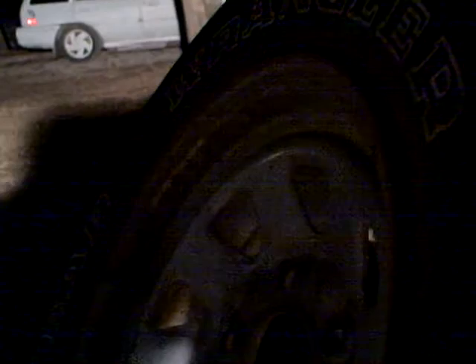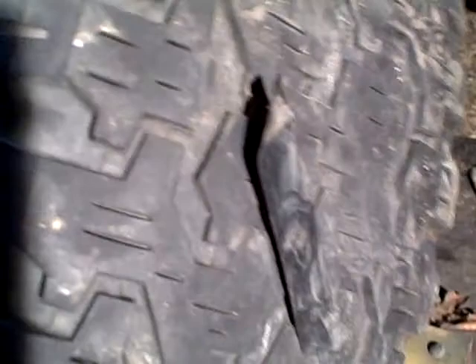Let's break this — I don't know if this one was supposed to be broken down or just patching the hole here. I think this one's supposed to patch the hole in it. So do we want to really break this one down tonight? No, I can show you how to patch it too. Alright, let's go ahead and leave this tire on this wheel. Since we discovered why it was off the truck, we still have to take the valve stem out — actually, we're putting it back in. We're going to patch it from the outside. This was marked with a piece of tape for our reference, a good mindset to not waste the tire. Since we don't have any money to do this stuff, we've got to save every bit and piece we can.